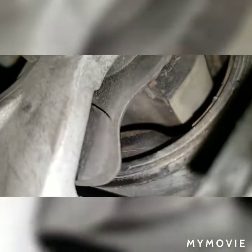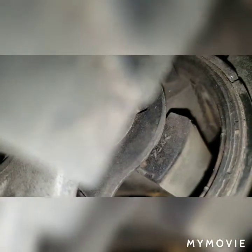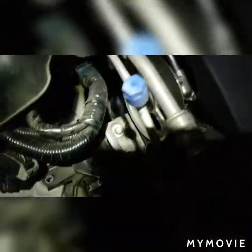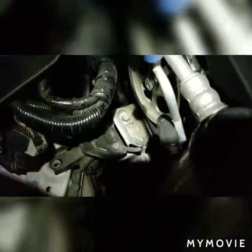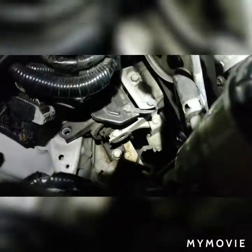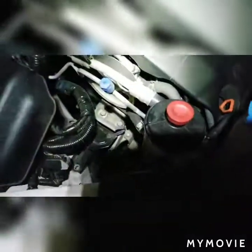As you can see on that other side, let's see, can't really see with this mount. Oh, there's a tear right there. But you can see the edges there. The mount is completely deteriorated on that back side. All right, it's making more progress. Got that. Got the center bolt out there. All these are size 17, except those 2 right there, which are size 14. Had to move the power steering reservoir out of the way, and also had to move the coolant reservoir out of the way. Making progress.